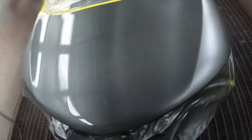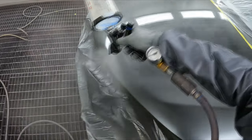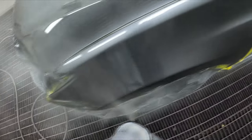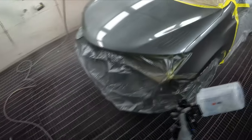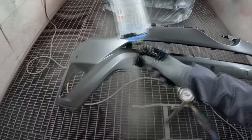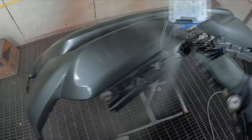I've been on the 1.2, which is obviously a little bit slower as you'd expect, but it was really good for the Mazda — the previous job I did. Everyone knows they don't put much paint on their Mazdas. It's actually a nice fan on this, nice and fast. You cover a good amount of area per pass. And at 40 psi you'd expect to use more paint, but you don't — I don't seem to be using any more paint than with my Pro Light.